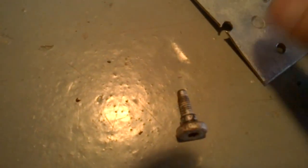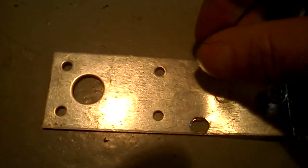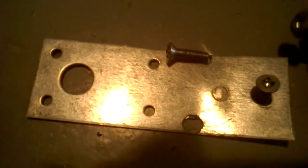At the end, when you have the three screws in the plate and it seems like the clutch is coming out well — don't pull on it. Remove the plate first, then unscrew the center bolt, then remove the clutch plate. This matters especially if you later need to readjust the shims.